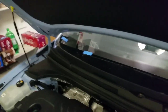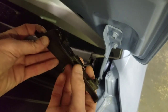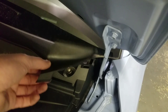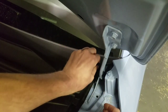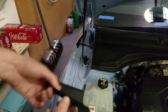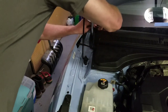So let's go ahead and grab our end pieces here for the driver side and passenger side and get those installed. These end pieces have your two tabs right here and here, and they slide up underneath the windshield - you cannot get these mixed up, they only go in one way. Put the windshield tabs up underneath first and then get this aligned - that'll click in. Everything is clicked in there. Same thing with the driver side - put the tabs underneath the windshield first and then put these tabs in until it clicks.